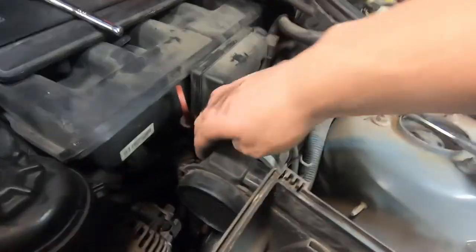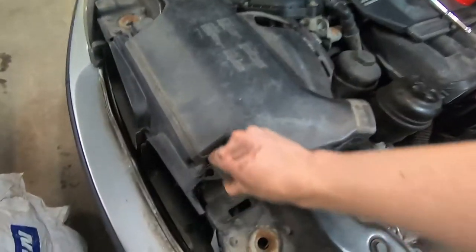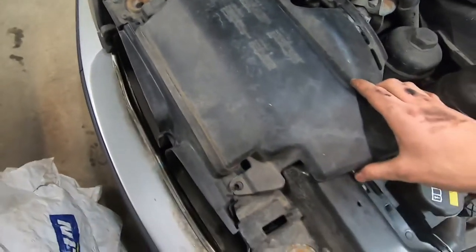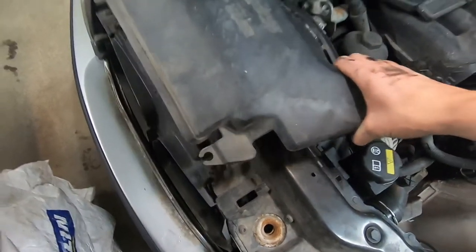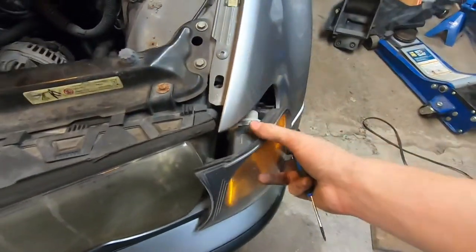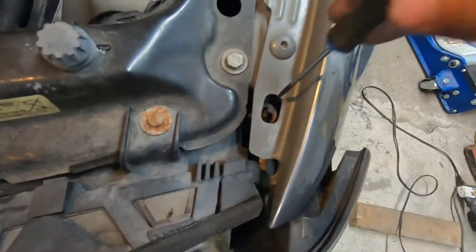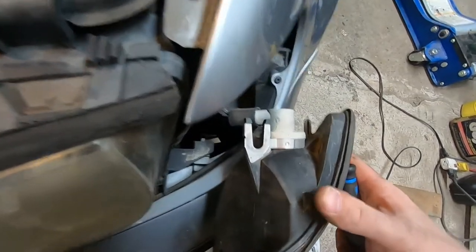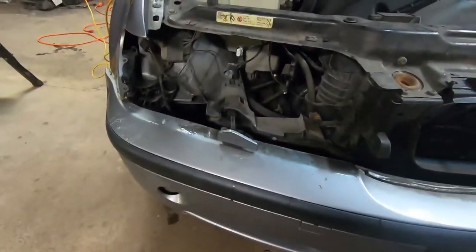The only thing left holding it in is the little air duct that comes from the front, allowing air into the box. That just slides out — you wiggle it back and it's out. You could have disconnected it up at the MAF sensor for a bit more room, but this way works. I also took this piece off at the beginning — it clips in with two spots. Some BMW clips you push through the center. Next, the side lights are really simple — there's a Phillips head in the gap, spin that and it'll loosen, then disconnect the cable.